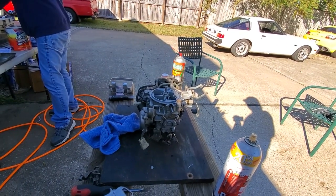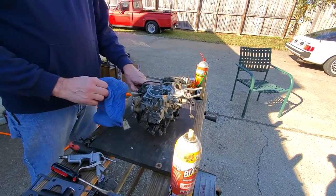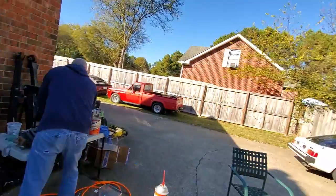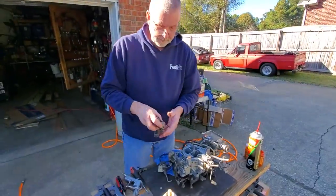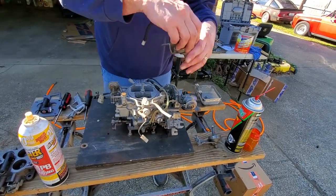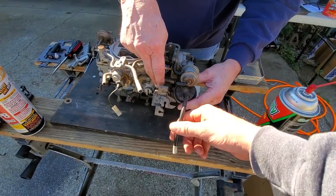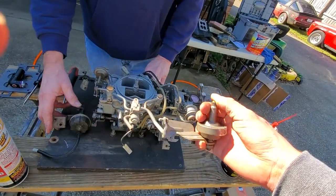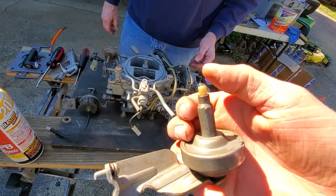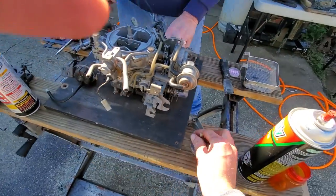There are other parts that go on here as well. These kits are made for '79 to '83 or '85, so they've got some extra parts in them. There are two different versions of some gaskets - some have a little hole here because there will be two bleeds that come up to this position. Some carburetors have different configurations: some have two screws on the body, some have it on this part. There's just different ones for different years. They make one generic kit that fits all of them.